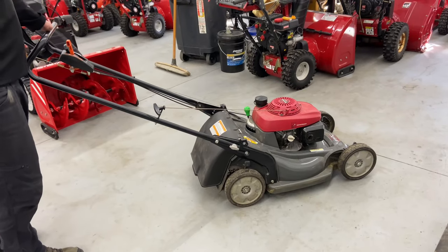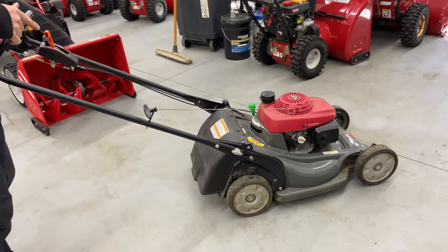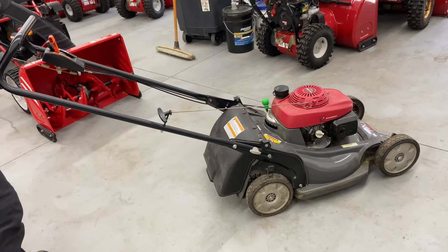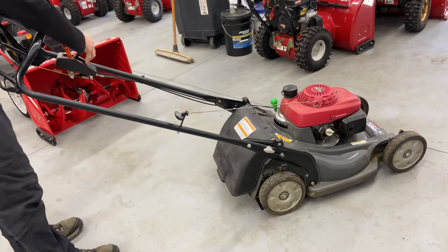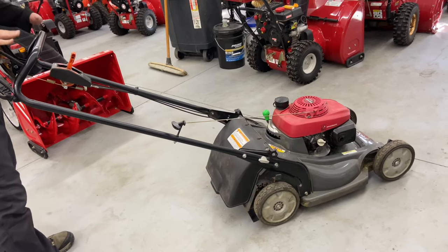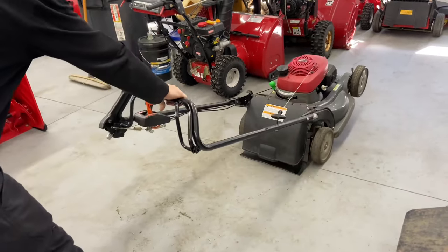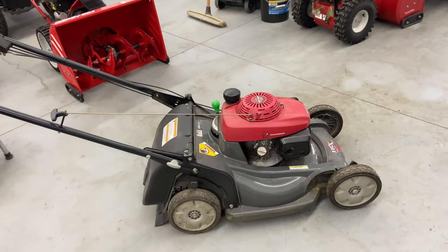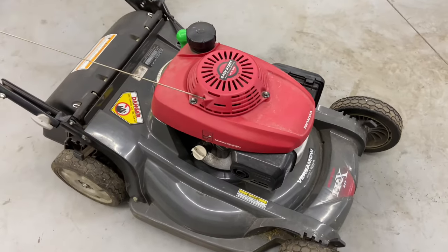I'm going to fire this up and see if the rear wheels are spinning. If your rear wheels do not spin after you lubricated the keys, then you may have them in backwards or may have another issue. I would not usually start one of these up inside my shop, but this has a clutch on it, so the blade will not be spinning when I run it. So that pretty much sums it up for how to grease the rear wheels on a Honda HRX 217. If you guys have any questions or comments, please leave them below. Please subscribe and tell your friends about my channel — I appreciate everybody watching, and I'll catch you guys on the next one.